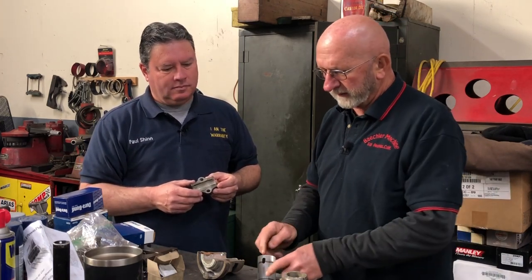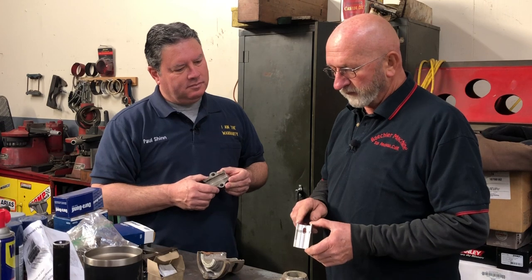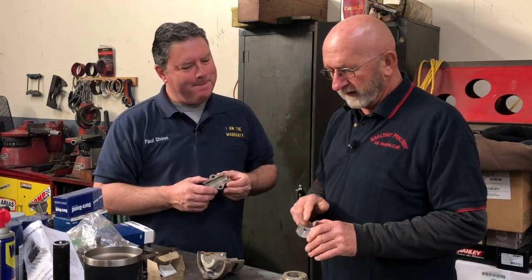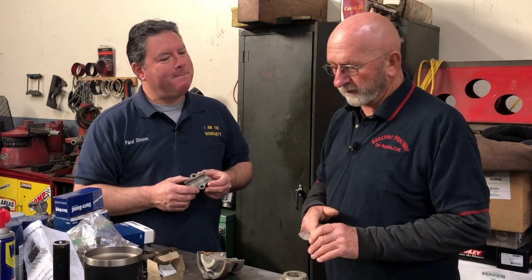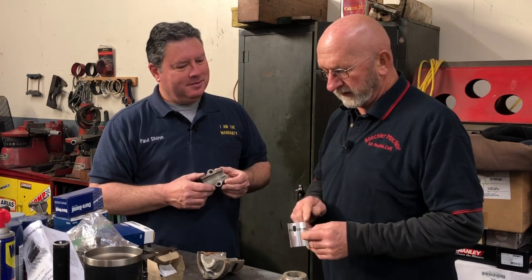The bronze shells took the majority of the load, with a fine layer of tin — the Babbitt — machined out, and they found that to be working pretty well. Then in the 1930s they went with steel-backed shells and found that to be even better. The problem with steel is you've got to tin it so the Babbitt can stick, otherwise it flakes off. So Packard, Lincoln, and Cadillac decided to copper-plate the shells, because the Babbitt would stick to copper better than to steel. Now they spin the tin into the steel shell — that's how modern inserts are made.